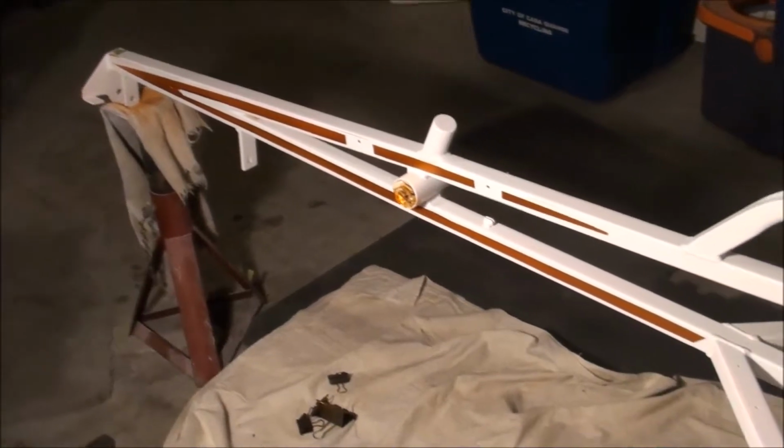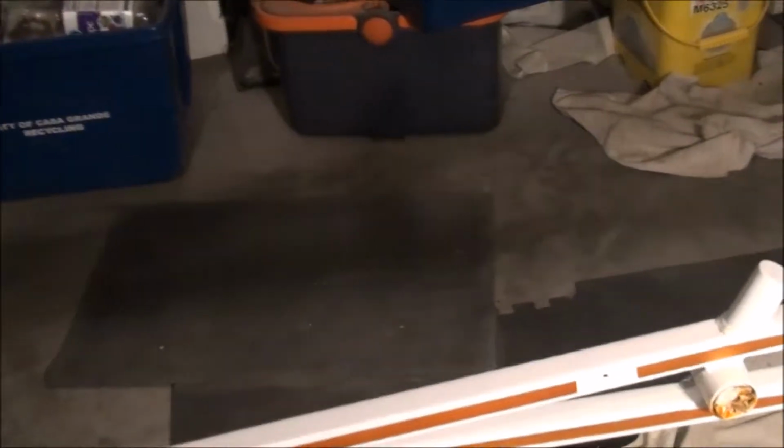And that's it. Well, viewers, we got this all touched up now, so it looks just about the same on the other side. Just about. So all we need to do is let this dry and go over it with some 1000 wet and dry on the edges, you know, just sand block it. And same thing over here, but I gotta let this dry for 2 days. This one's ready to be sand blocked, and I'll go ahead and sand block it with the 1000, get the edges off, and start taping this out with the green tape.